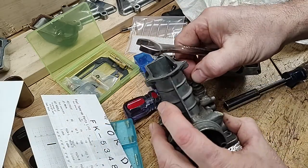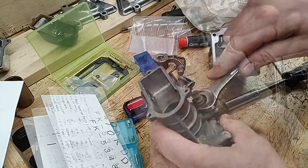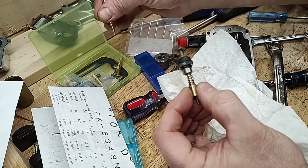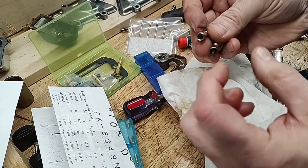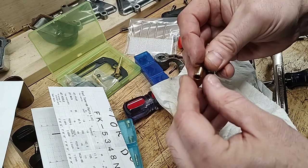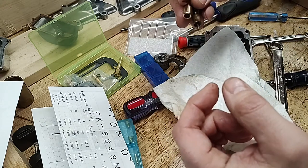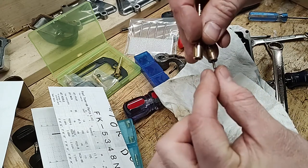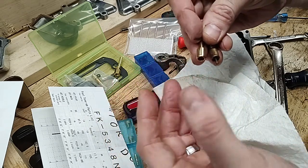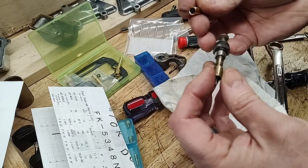Choke, or the starter plunger, is where things get a little disappointing with the Keyster kit. A replacement plunger is provided in the kit, but lacks, for my purposes, the pointy end. This goes into the starter fuel passage, and I'm not sure what the effect would be of not having the pointy end when the choke is fully open, but it certainly would affect the flow of fuel at partial choke. Again, it's an omission that isn't terribly important, as I can easily clean and reuse the existing plunger, as I did on my other two carbs.